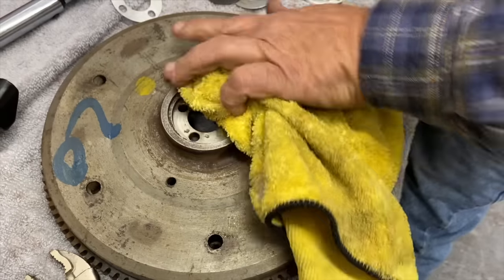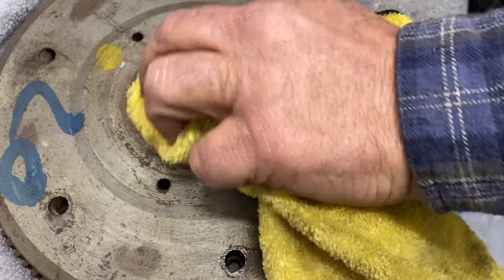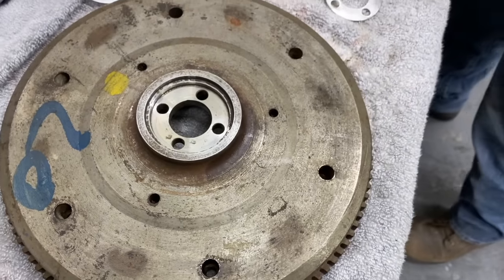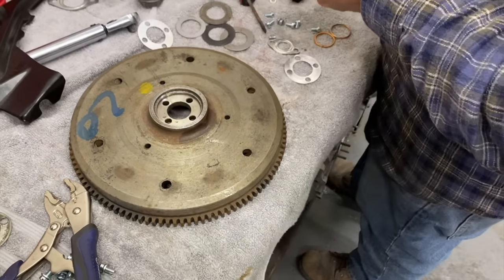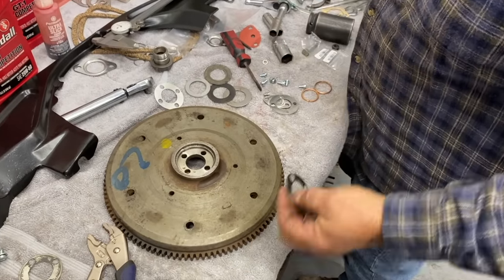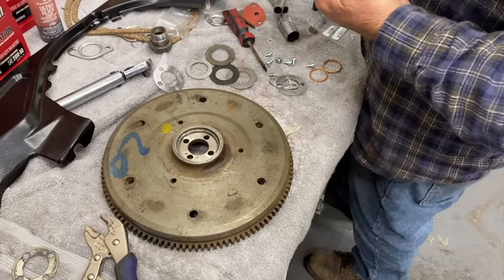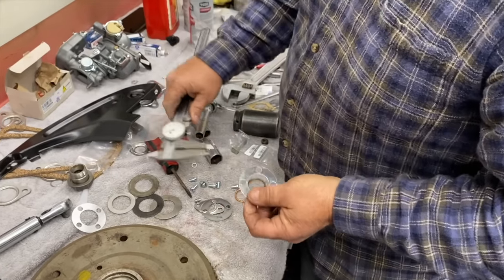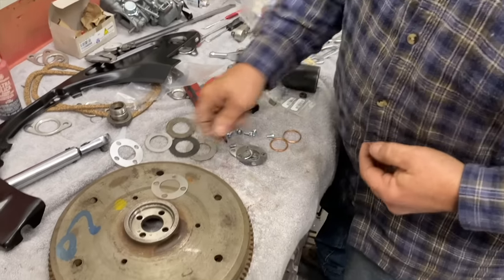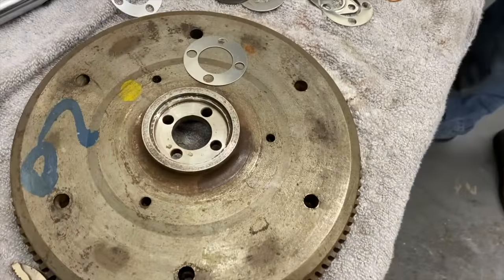And one other thing about the sealer on the case. Volkswagen did not put any sealer on the case halves from the factory. Wow, interesting. Yeah, they never had sealer. But after you rebuild them and they get worn, you have to put some sealer on them. Gotcha. But from the factory, there would have never been any sealer, because they were just machined and they were machine tight. The surface was so good.